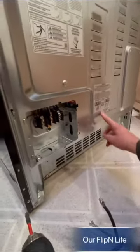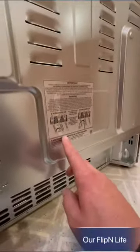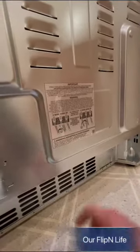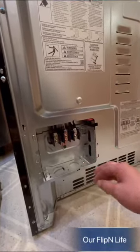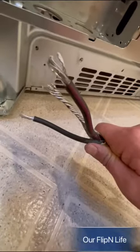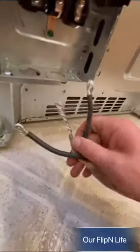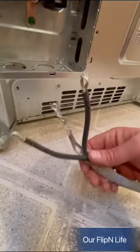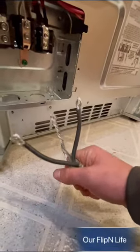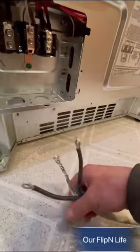If you look on the back of these ovens they usually have your instructions. What we have is the three-wire hookup: the red goes on the right, the black goes on the left, and the white goes in the middle — the white is the neutral. These are just Phillips screws, so it's simple. On the wire there's a red stripe through the red one — that's usually how they indicate it. Just hook them up like it shows on the back; it's super simple, just three hookups and you're good to go.